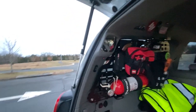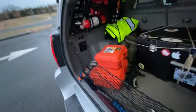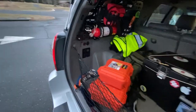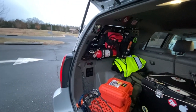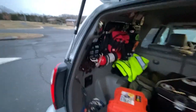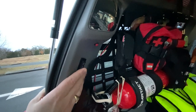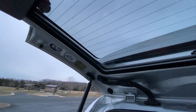This push button switch is wired into the tailgate — if the door is closed and the car is unlocked, it will open the rear hatch. It's pretty annoying to open the hatch from inside when you're camping out of the back — you have to break into the paneling, cut away weather stripping, and pull some weird lever in a very specific way. This other switch controls the rear window and also locks and unlocks the car, which you kind of need in conjunction with the push button. Down unlocks the car and rolls down the window; up locks and rolls up the window.